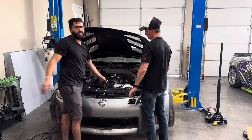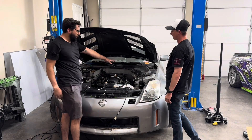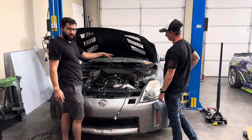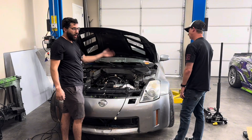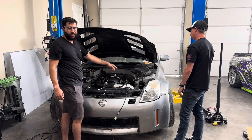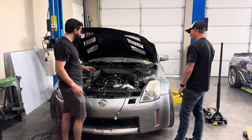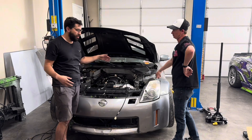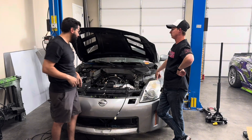How to tell which side is your odd and even side: if you look from the top of the engine, you will see that one of the heads is actually more in front of the other. That is going to be your odd side because it starts at cylinder number one. No matter which side of the car you're on, one head is offset to the other — it's just the way the LS is, because one piston is in front of the other.